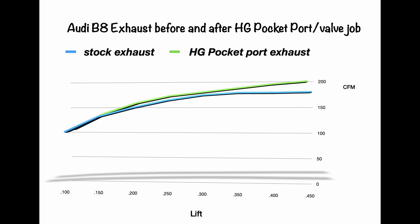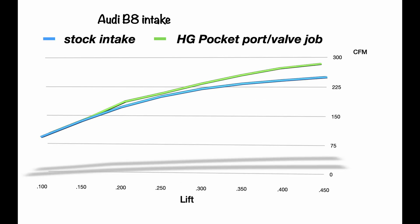We're going to take a look at the exhaust first. From the crack of the valve to 150 lift, we're almost dead even to the OEM. But by 200 lift, the Head Games just starts building up, and at 300 lift, the Head Games pocket port and valve job just walks away from the OEM up to 450 lift — this thing is just gangbusters. On the intake side, again from the crack of the valve to about 150 lift, we are looking at almost a dead race between the Head Games pocket port and the stock intake. But by 150 it starts walking up, and you see at 200 lift the Head Games pocket port is alive and well — it picks up a good 30 CFM throughout the range. This thing just walks away from the OEM. It is ready for boosted beating.